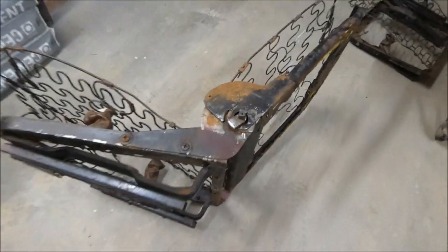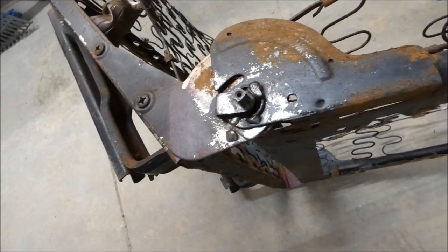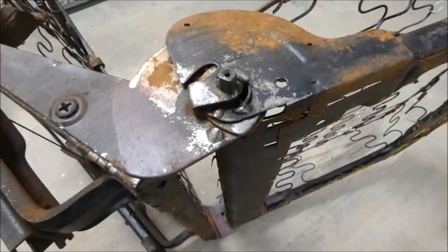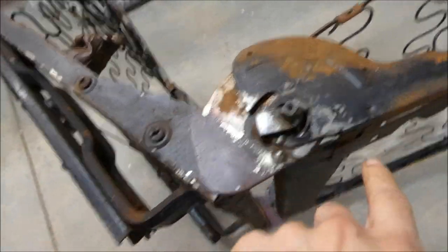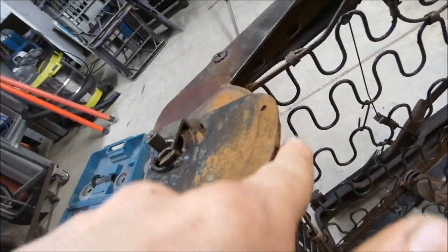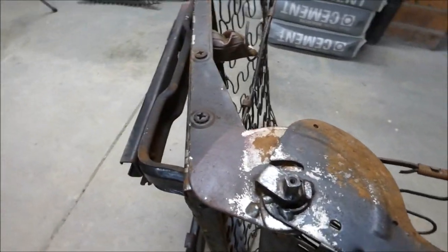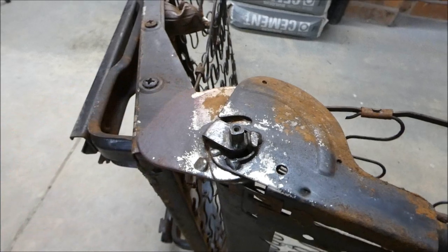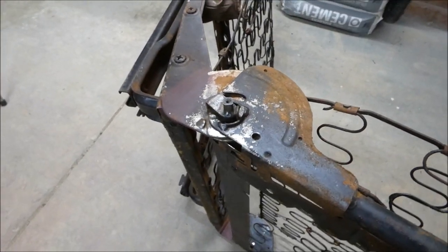So what we're gonna do, I'm just gonna break this one down even further. This one's the passenger side, which doesn't get used as much, obviously. It's in really good nick. So I'm just gonna remove these welds, where the spot welds are and stuff like that, these welds here. And then it's got a couple more welds along there. I'll just cut through them and start removing section by section, and then I can see exactly what shapes I need to make, and then reverse it all and put it all back together. Wish me luck.